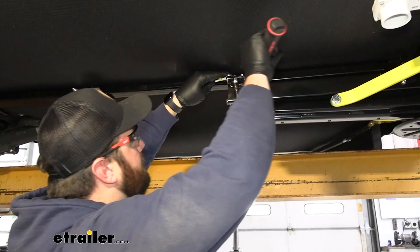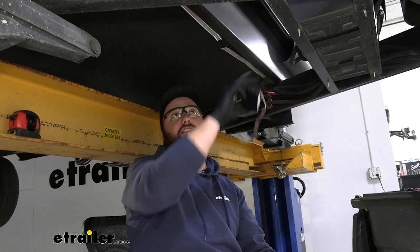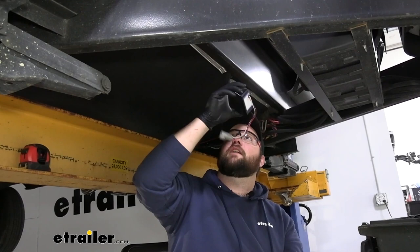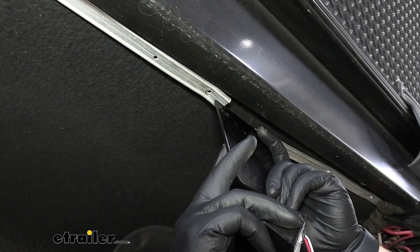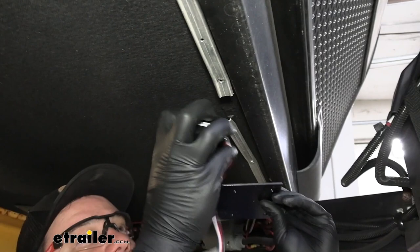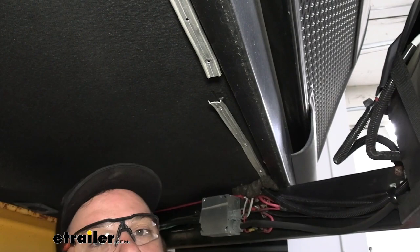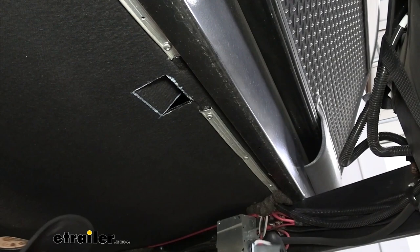To get our sensors installed, we're going to have a sensor for the front and one for the rear. Your front sensor has to be within 36 inches of the front of your camper. We have a brace behind this trim panel as one option — another location is 39 inches back, so we can't use that. We trimmed the piece of trim back about an inch on each side so the sensor can self-tap up into the brace, and we cut a small hole in the belly so the sensor can slide up inside and be protected.